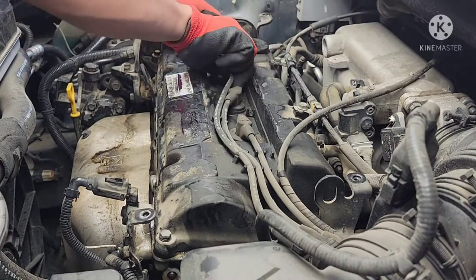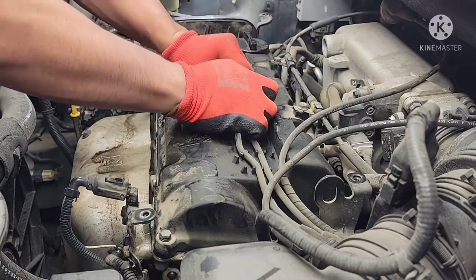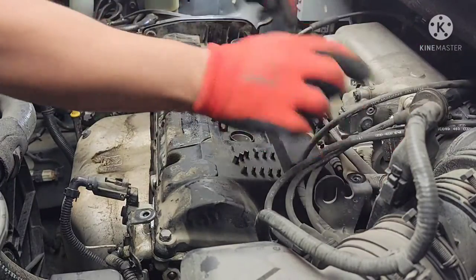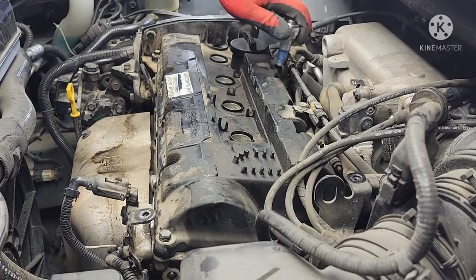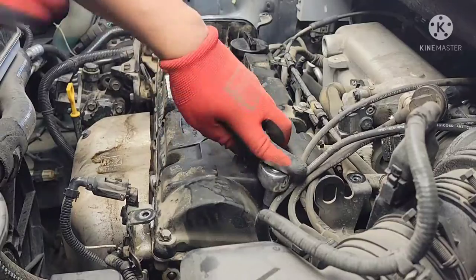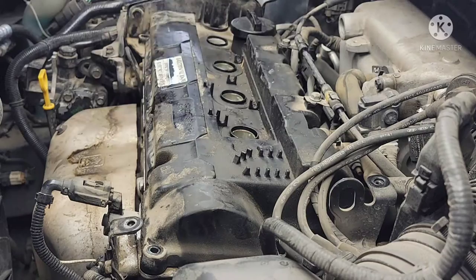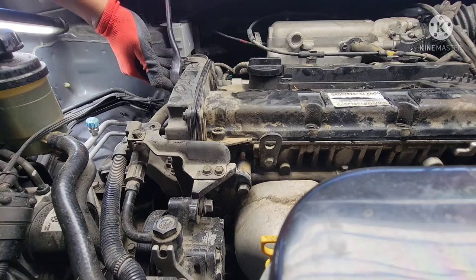It's better to put silicone grease on there when we put it back — silicone will help save that rubber boot. Looks like these are all 10 millimeter bolts all around here. There are two bolts on the timing cover — take those off.